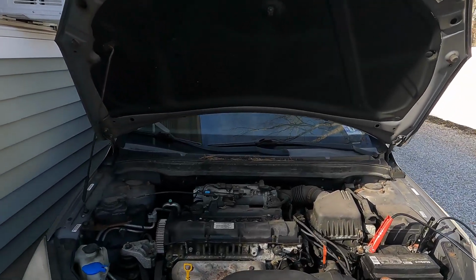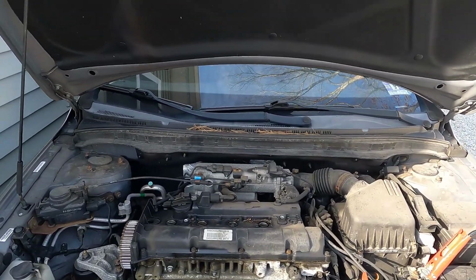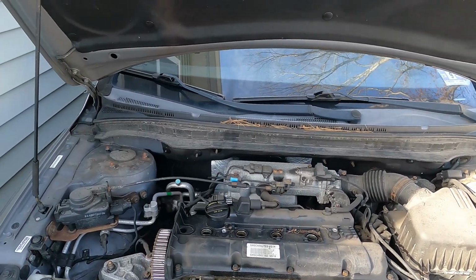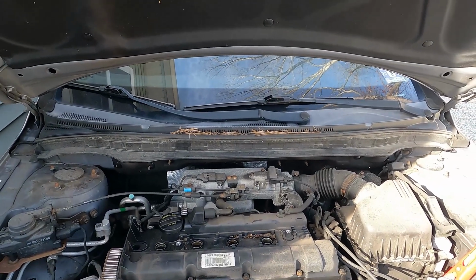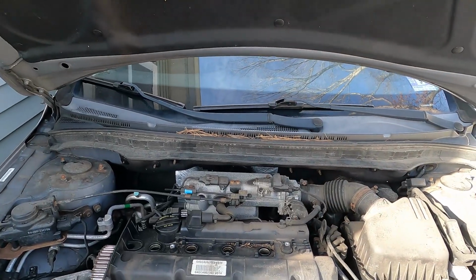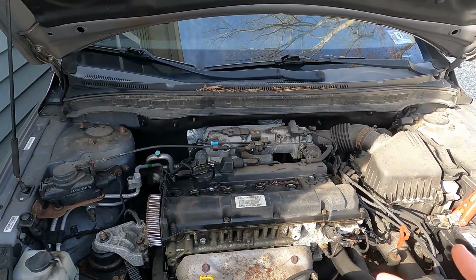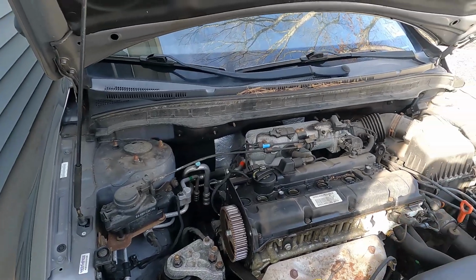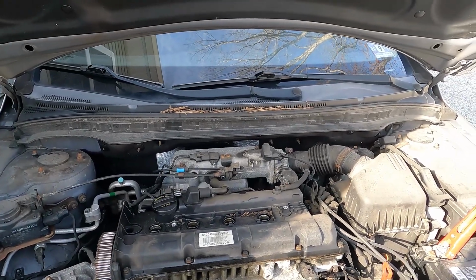Alright guys, and that is going to conclude this video. Now that we have confirmed our suspicions that we do have piston to valve contact, in our next video we're going to go ahead and start tearing into this thing to get the cylinder head off. Now like I said, these heads come off pretty easily. We're probably going to leave the intake manifold on the head and remove it after we get it out. It's just easier that way instead of trying to sneak your arms back there. But we'll pull the intake air box out, get all this out of our way. We'll pull this exhaust heat shield out of the way, get the exhaust manifold off, pull our inner timing cover off, and at that point we'll be able to pull the valve cover and remove the head.